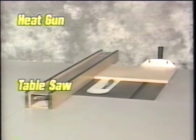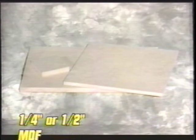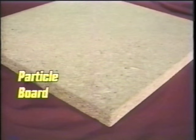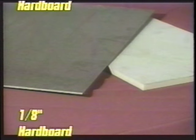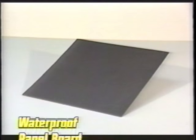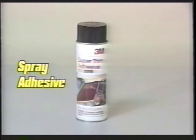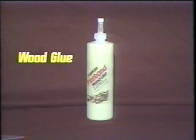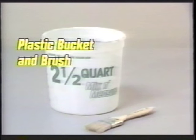The following is a list of the recommended materials: quarter-inch or half-inch medium-density fiber board, also known as MDF. A high-grade particle board may suffice if MDF is unavailable. Quarter-inch hardboard, eighth-inch hardboard — ABS plastic sheets are suitable substitutes. Waterproof panel board, grill cloth, spray adhesive, wood glue, polyester resin, catalyst or MEKP, a plastic bucket, and a paintbrush.